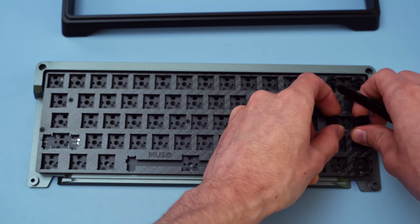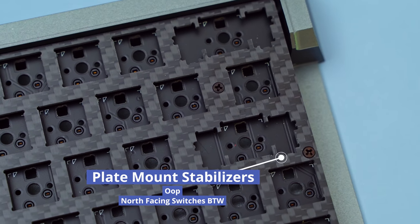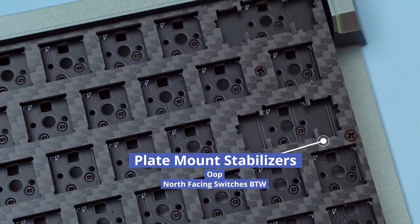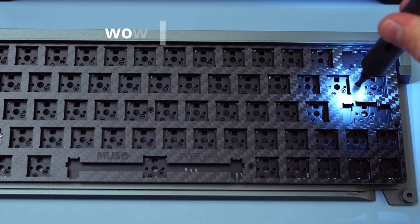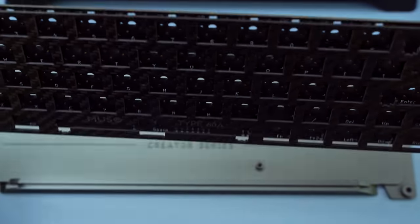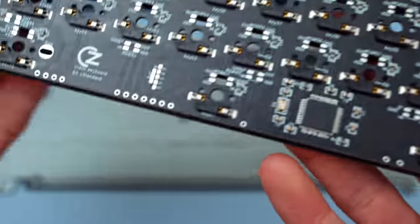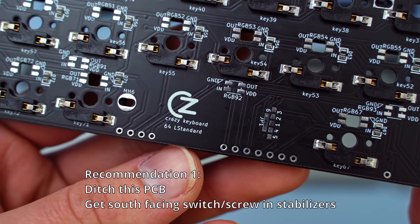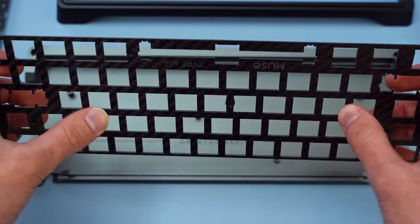I think honestly it would be better if they didn't include the stabilizers, as it's just really a bad look to include this cheap of stabilizers with an expensive board. Here's the deep dark secret: this board doesn't support PCB or screw-in mount stabilizers, and it's north-facing LED, but doesn't even have any LEDs. For those of you that are new, north-facing LEDs cause a little bit of interference with Cherry Profile keycaps. Normally it's justified for the sake of RGB, but there's no LEDs here, so it's kind of hard to defend. Recommendation number one for Musou: get rid of this PCB and find a different one to use. This would fix the north-facing LED issue as well as the stabilizer issue with one fell swoop.